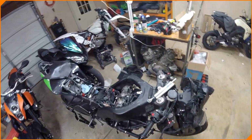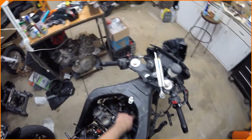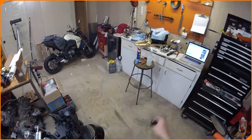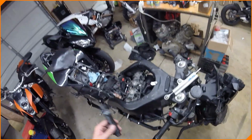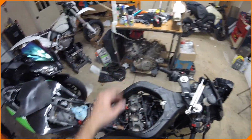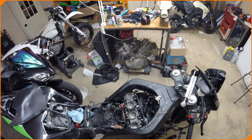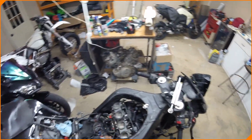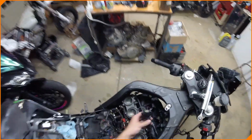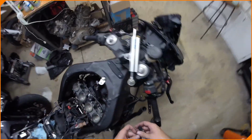Let me show you how to install cylinder 1 and 4 on this bike. Now, according to the Kawasaki manual, to change these coils, or your spark plugs for that matter, you take all of this off. You get down basically to this point. You gotta take your box off, you gotta take your velocity stacks off, you gotta get down to this. Then, you would think, oh, I just drop them in there. There's no room, Zan. What am I gonna do? I can't do it that way.